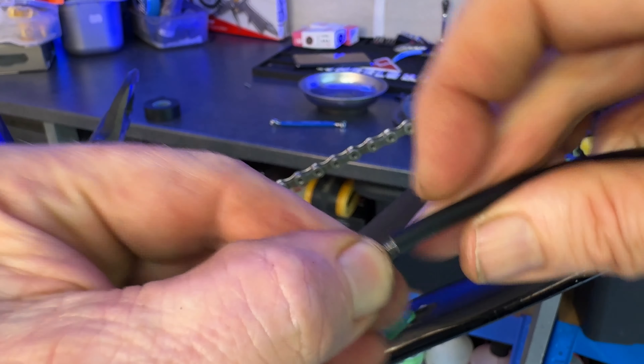Tool attached at the other end — let's feed it through. There you go, as simple as that. Quick top tip: the routing tool being threaded into the hose will have damaged that end of the hose. Grab your cutting tool and just snip about a centimetre off so your barb has got something clean to connect to rather than a flared end. Now we go through the process of connecting everything back up — and trust me, you want to start at the caliper end. The run between the caliper and the frame is very short, which makes it extremely hard to work with, so because it's not plumbed in you've got a bit of movement on the hose.